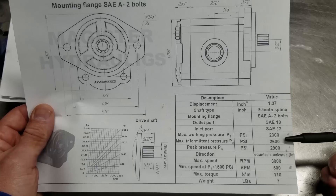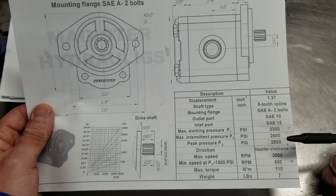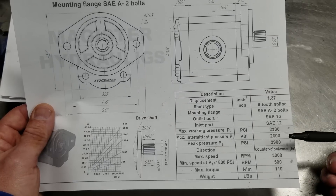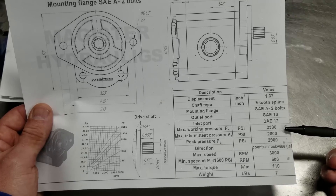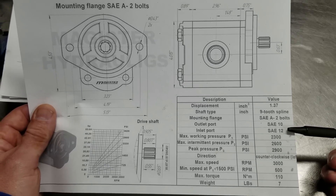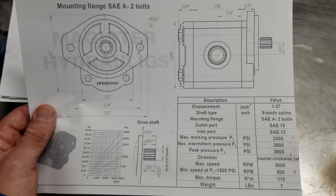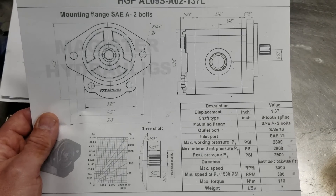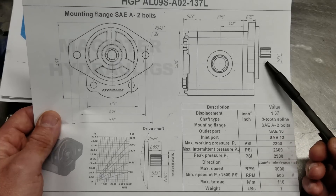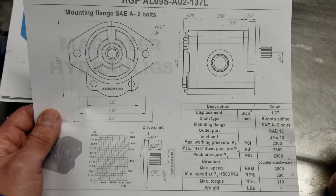Keep in mind the flow regulation valve on the OEM pump is probably trying to maintain four to seven gallons per minute. Divide 15 by two — that's about 7.5 gallons per minute. Driving on the freeway at 60 mph we're at about 2,000 RPM, which gives us about 11.5 GPM, ending up at around five to five and a half gallons per minute — the sweet spot for both the air conditioning compressor and the steering box. This company makes any flow rate you can imagine, from one to five GPM all the way up to four to 18 GPM for this shaft size, with an SAE A two-bolt mounting flange — which is what our trucks use off the air compressor.